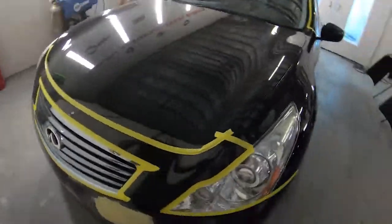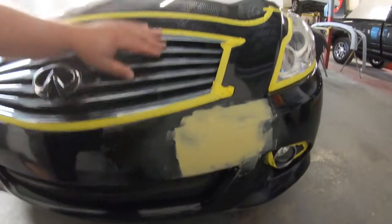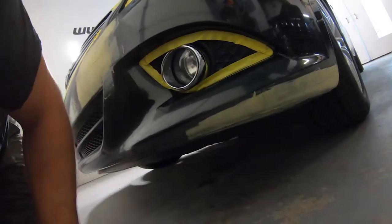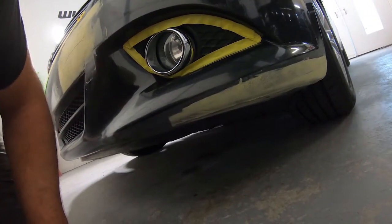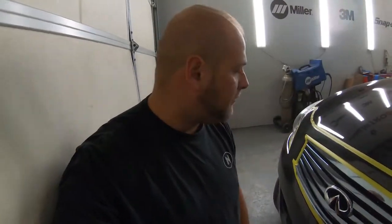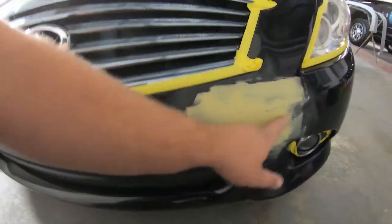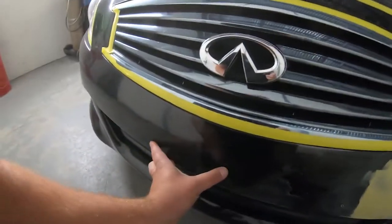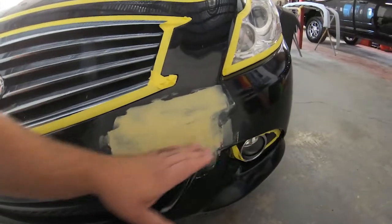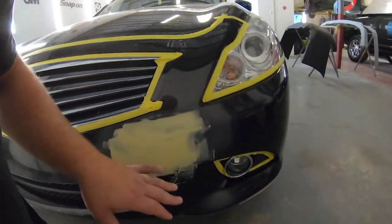On the front here — it's a little dark but you can see — we had a scrape down below. Nothing too crazy, just a bumper scrape, pretty easy fix. There are lots of rock chips so we're going to go ahead and color out the whole front bumper. There was a license plate bracket that was off-centered, which I thought was kind of weird, and when I removed it it turns out there was actually a crack behind the license plate bracket. It was kind of a clever way of hiding the crack — I'm guessing the previous owner did that before selling.